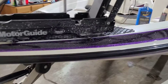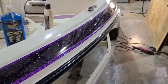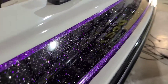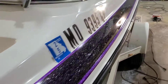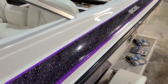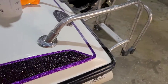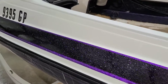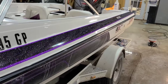Here's our finished product using the method I just showed. It's decent — it could be better. Some of the gel coat is faded in certain areas, so it's harder to tell. Something I forgot to mention: you've got to use water when you're sanding — it's a wet sand process.